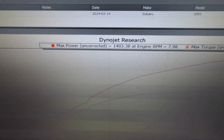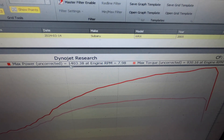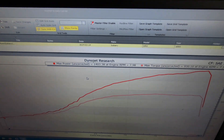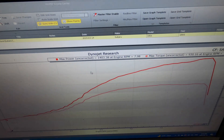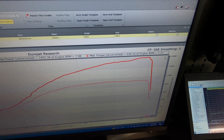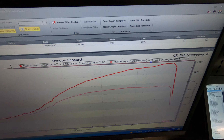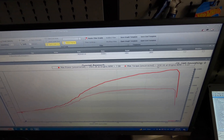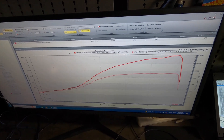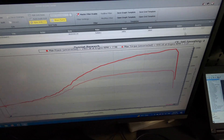Oh, look at those numbers — max power 1403.38, torque 930.16. This is uncorrected, real numbers — no correction factors being applied. This is what the car actually made on the rollers today. Not altitude corrected, not corrected for cold weather — no one's tricking any sensors. This is what this car just made: 1403 horsepower on the steel rod four-cylinder EJ motor. Not bad at all. I'm pretty happy with it. I kind of wish I had revved out a little further — it was still climbing — but stuff is so violent inside the car and we're just trying not to overly abuse it, even though that's what we're doing. We're going to keep digging into the data and see what we can improve and try to get another 50 to 100 horsepower out of it, which I'm sure it has in it. Thanks for watching, and I hope you enjoyed those crazy loud noises — the Subaru fury.